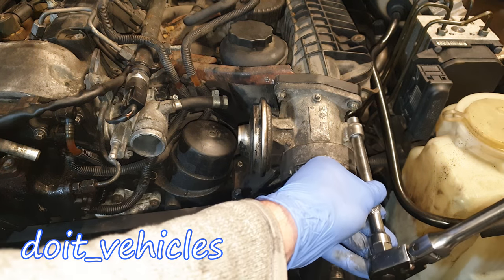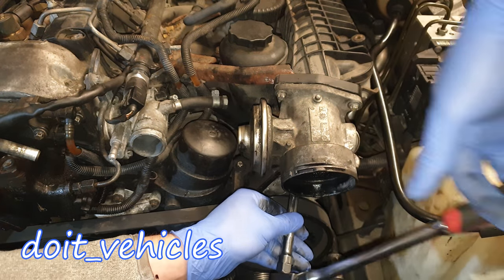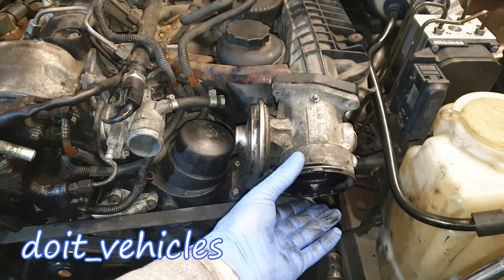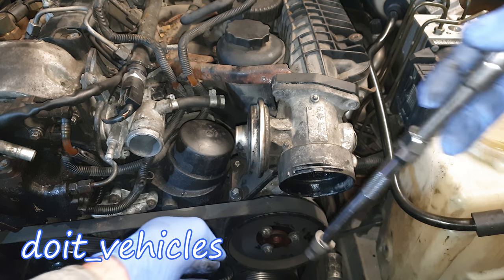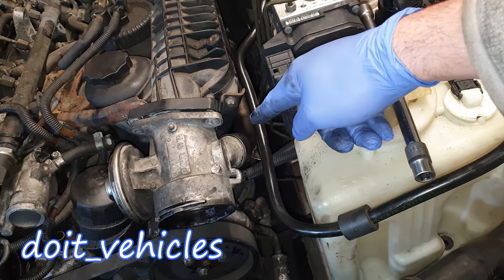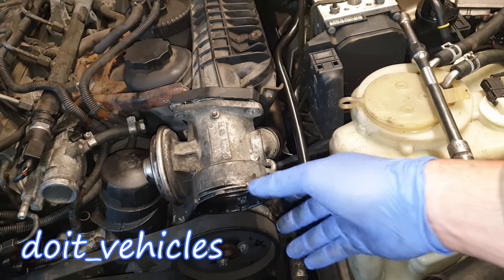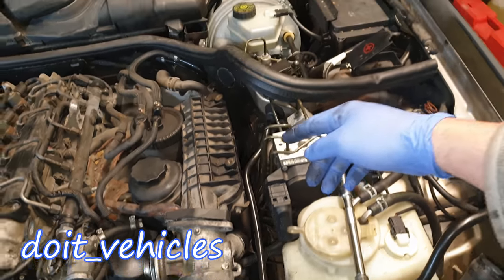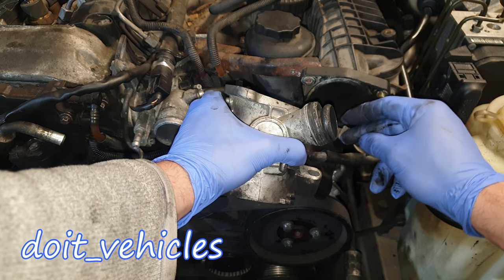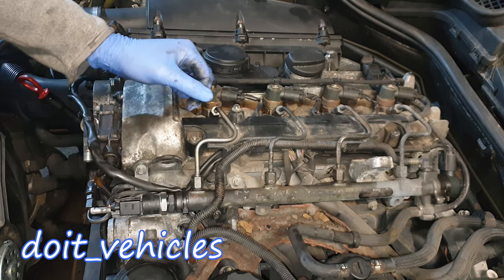Use an E10 or an 8mm socket — they work the same, but E10 is much safer to use. You've got one bolt on the bottom here, and the bolt from this corner is a lot longer. With the E12 let's remove this bracket which holds the EGR valve on the power steering pump. Disconnect the hose which connects the EGR valve to the exhaust manifold, and disconnect the vacuum line as well. The EGR valve is off together with the bracket.